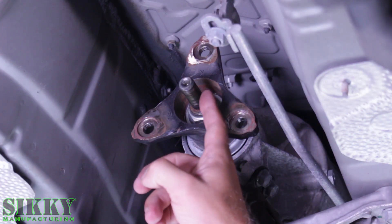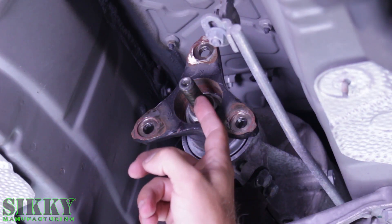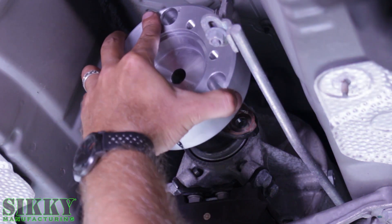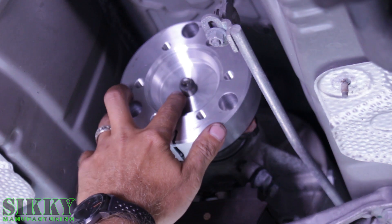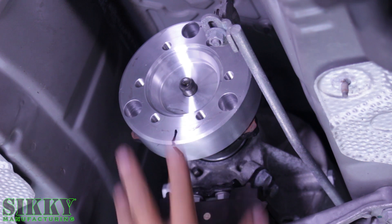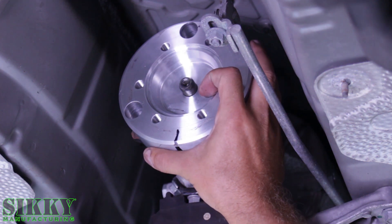As you can see, the pin sticking out of the transmission flange sticks out a little too far, so you're going to need to trim it. You can see when you put this on it sticks out here — you want to get it down pretty close to flush with the bottom of this plate. It's about a half an inch we're going to trim off of there.